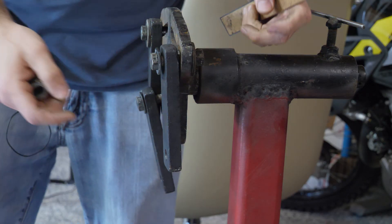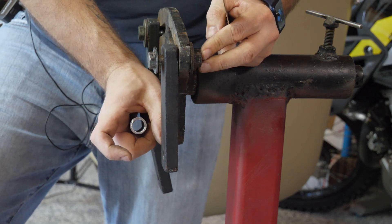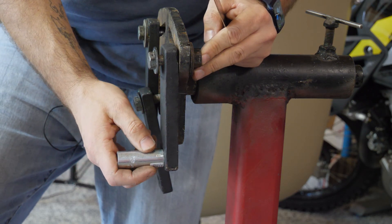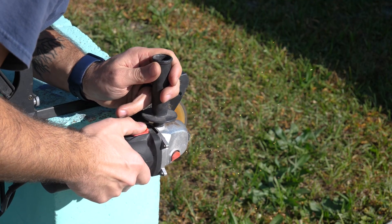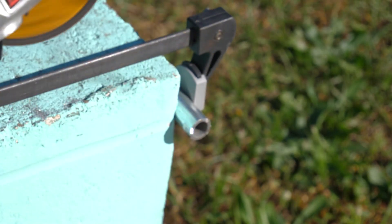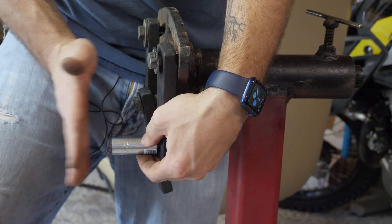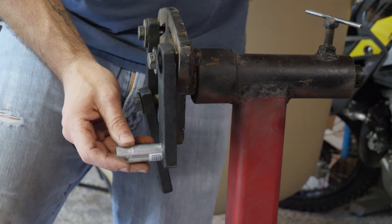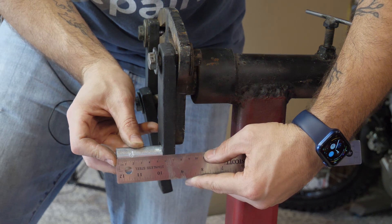Next, you want to measure your mount. I'm just going to take one of the arms — normally these have a little sleeve on them, but I had to make my own since mine didn't come with any. I just took some really beefy half-inch conduit, cut it down to size, and cleaned up the edges. That's going to allow me to keep the engine this far away from the mount.